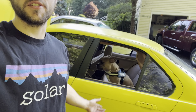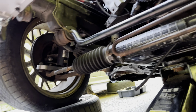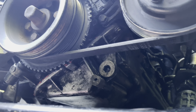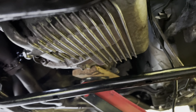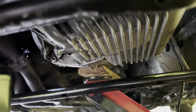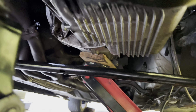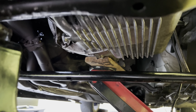Welcome back, so it's another night and we're working on the car again. Last night I actually made a ton of progress. I got the oil pan in — what I did was put some high-temp gasket sealer, just the thinnest coating possible, and got everything tightened down. Let that cure overnight. I degreased everything while it was out of the car so it looks nice and clean. That'll be a nice telltale sign if it's still leaking — if it is, it's probably the rear main, which we will tackle after the event because at this point we just don't have time to drop the trans and all that again.